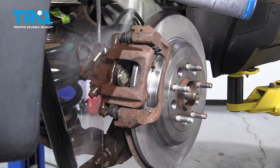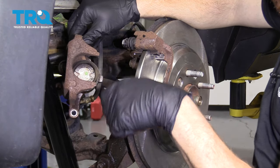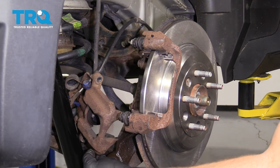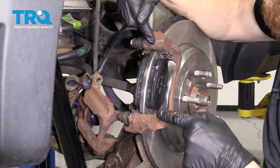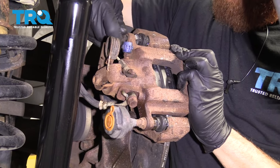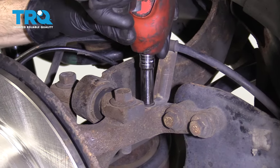Clean down your caliper. Let's get this bolt back out of here and get our boot back on — we want to make sure it's as dry as can be. Take a little bit of that caliper grease and go along the piston and then along each of these ears; these are the contact points where the caliper is gonna meet up against the pad. Let's get our pads back in there — they should slide right in. If you have to hit them in with a hammer, you probably didn't clean up your bracket enough. Grab our caliper and just slide it over the pads — it should flow right over there. Remember which bolt was on the bottom. Get our other bolt for the top. Let's tighten these up. Take this bolt and put it back in here.